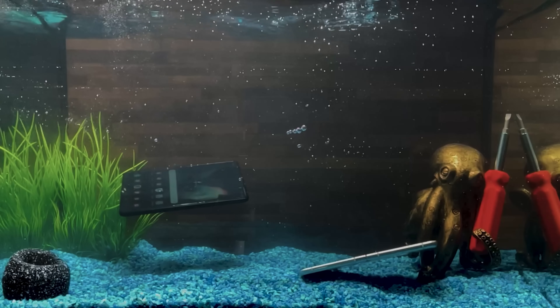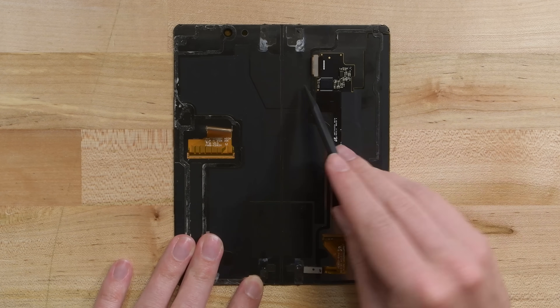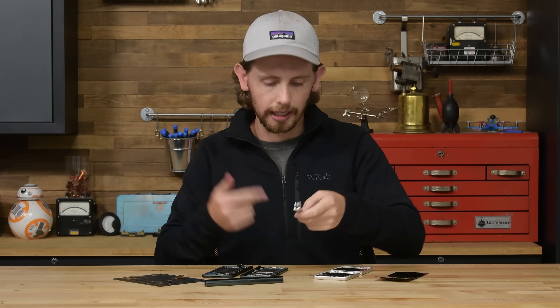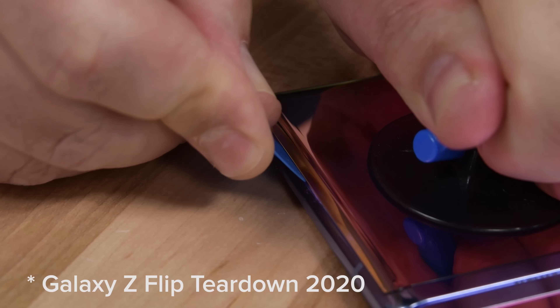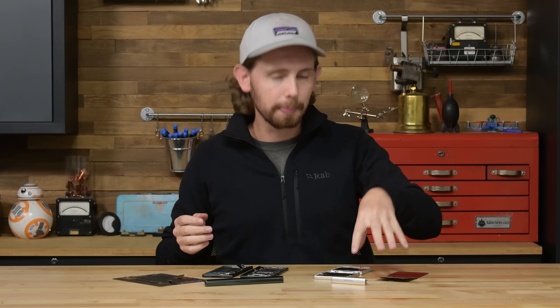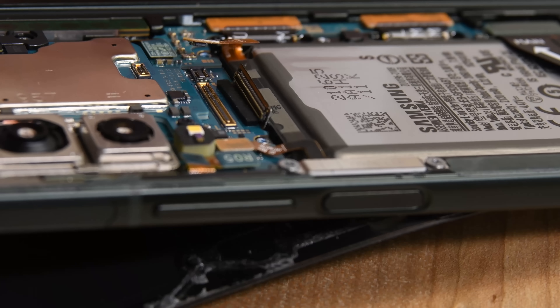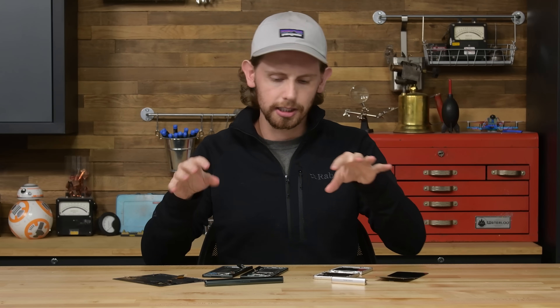So we've done our own research, and we found that Samsung was not bluffing about their fancy folding phone's water resistance. We could have just trusted their IP certification, but that's not fun. Our phones survived their time in the fish tank, and in each disassembly, we found a couple of subtle new ways that the phones are protected from liquid intrusion. The one thing we didn't notice was the lubricant that Samsung mentioned — I'm kind of assuming that's just lubricating the gears of the hinges. Through a repairability lens, neither of these phones is really that different from its predecessor. The Z Flip is probably the more repairable of the two, thanks to its screen and both batteries being reasonably accessible early in the disassembly process. But it's pretty obvious that neither one is designed with repair in mind. At least they're a little more durable this year, and hopefully now that Samsung has this folding phone formula figured out, they can start thinking about how to make them easier to fix.